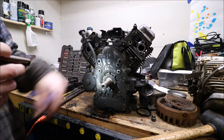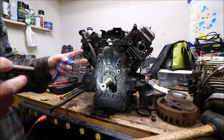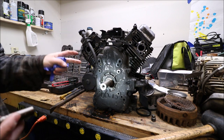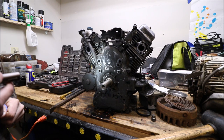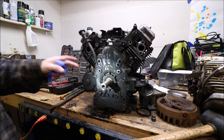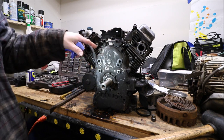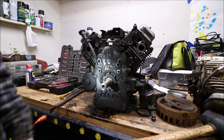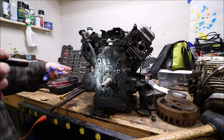Anyways, on the back side here, I was looking at it, and there's a seal on both sides of this crankshaft that you can replace. And like I said, there's a whole bunch of aftermarket parts that are available. And by aftermarket, I just mean parts for this that I can buy online. And I feel like with a good pressure wash and a few good parts in here, we could have a killer 18 horsepower engine that would work flawlessly. So we're going to see what this needs, but first of all, we're just going to open up this case. Looks like maybe some 12 or 14 mil bolts, and then a few springs and linkages here, and this case should just pop right off. And that's probably all we'll have to do here to see what is going on inside of this engine.